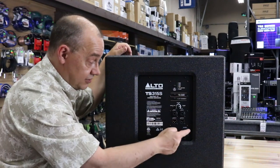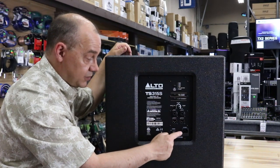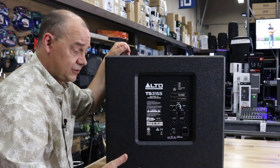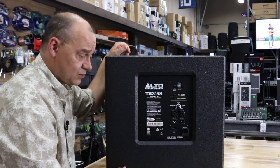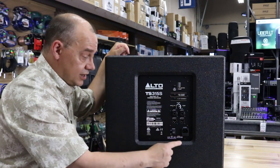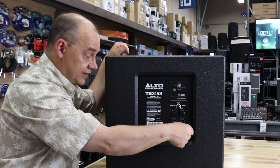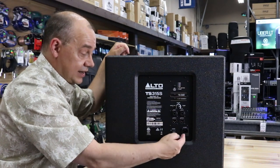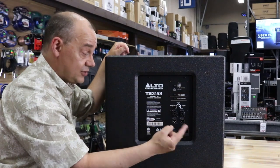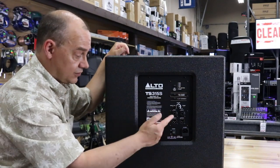At the bottom, your AC power cord. I've left it off this time so you can see the fuse tray located right below it. If you're ever not getting any power at all, take a small screwdriver, flick that out, and there's usually a spare fuse for emergencies located in there — you can swap it out and you're all good. And of course, the on/off switch.